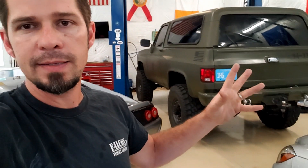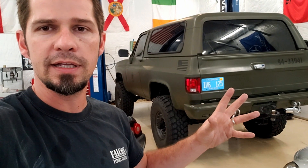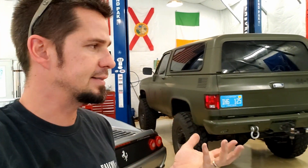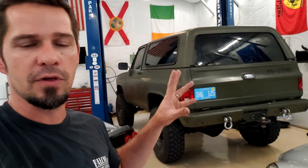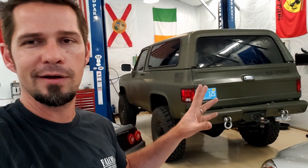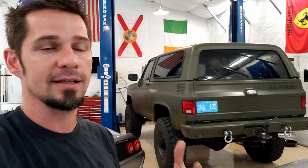The Blazer — I've got to keep telling myself it's 35 years old, it's been through a bunch of owners, and they all had different plans for the truck. I wanted to get it up to what I call 'Kenny spec.' On the outside it's pretty close to where I want right now, but I'm still trying to address the drivetrain. It leaks a lot — the oil pan is smashed in either from a rock or somebody jacked it up there, and the transmission is leaking. I'm also going to fix the turbo drain line because it's done kind of ghetto — it's going to pop and leak sometime.